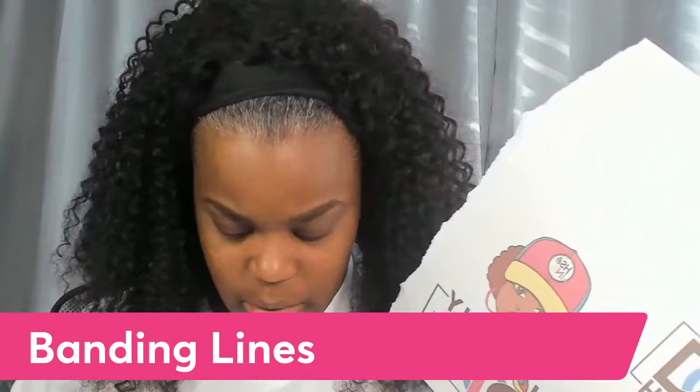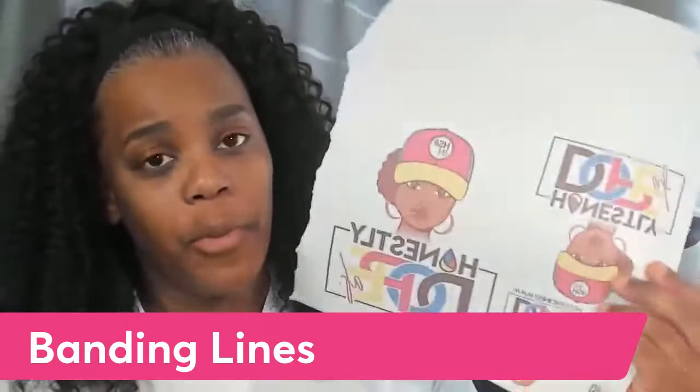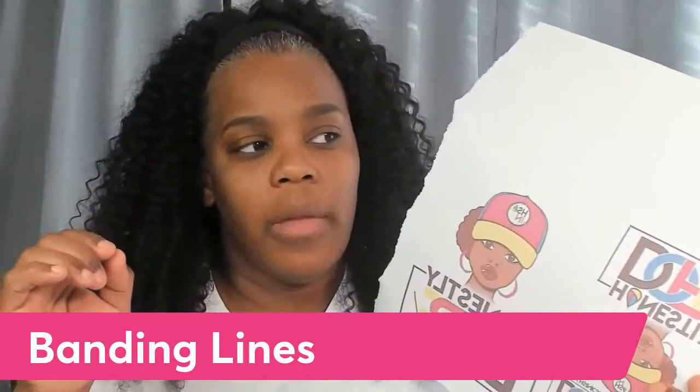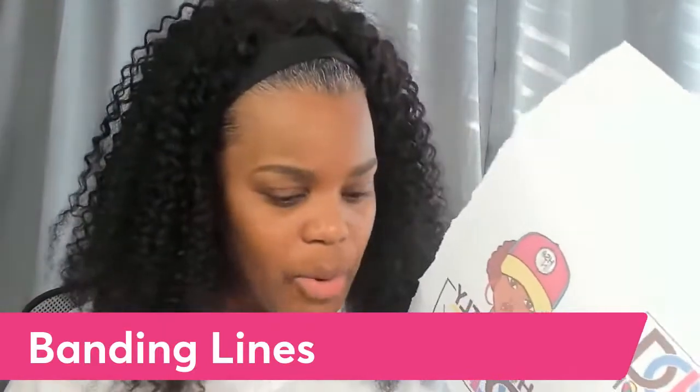You don't see the lines or anything like that whenever you're printing on plain paper, bright white, with your setting set to high and/or quality. You go to more settings and that's quality, and also turning your quiet mode off.